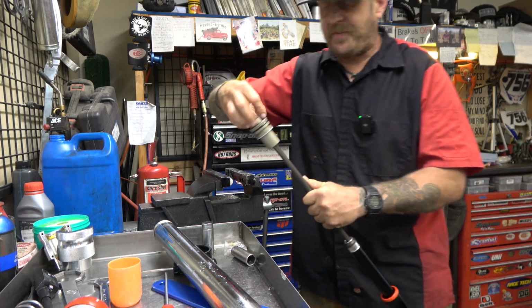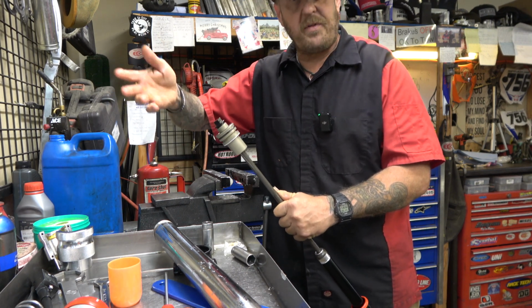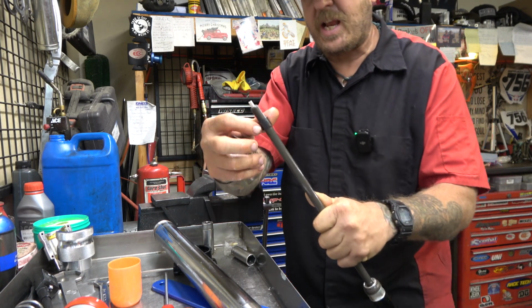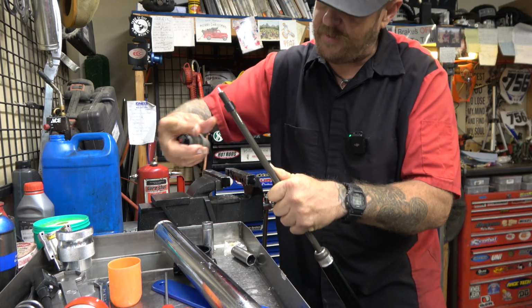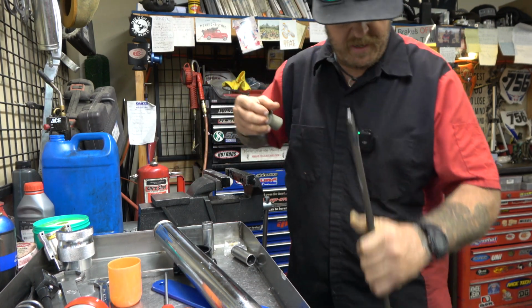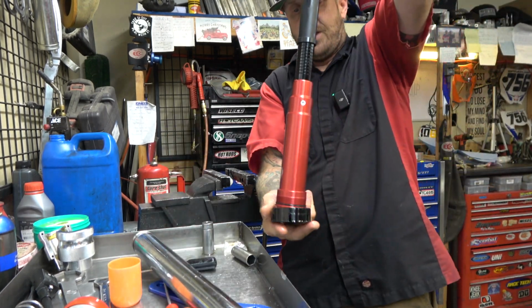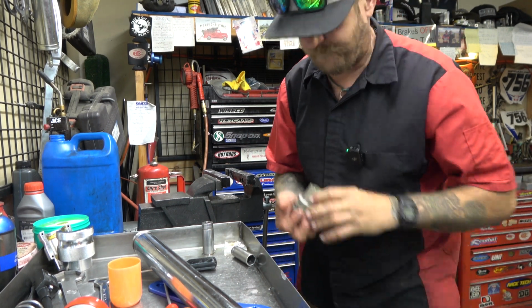This is the adapter. If you guys have not ever done like a KYB conversion or anything like that, this is how that normally goes. So this is not that weird. So with this, just like any other fork, you want to take this nut and spin it all the way down until it stops just with your hands. You don't have to get a wrench out. Then, I'll show you, fork tool, fits perfectly. You can set this down, that way nothing gets messed up.